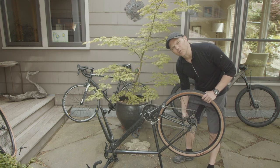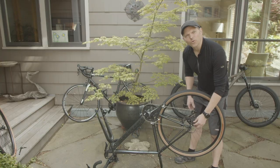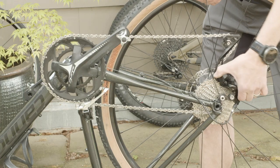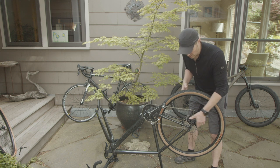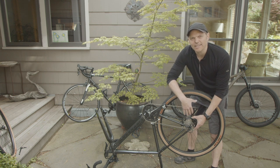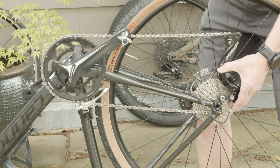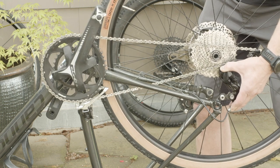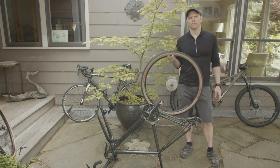What I want you to pay attention to when I'm pulling this out: I'm unwinding my through axle and pulling it clear out. The wheel can still spin sitting in its dropouts, same as before. But I'm just going to pull back on that thing — you see how it has the ability to come straight out of its dropouts. You pull back on the derailleur right there and you've got a cleaner shot to get your wheel out. When we're putting it back in, we're just going to do the exact opposite. I can pull that cleaner out of the chain and then I have my back wheel ready to go.